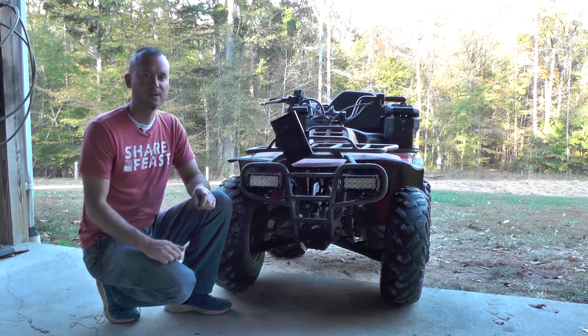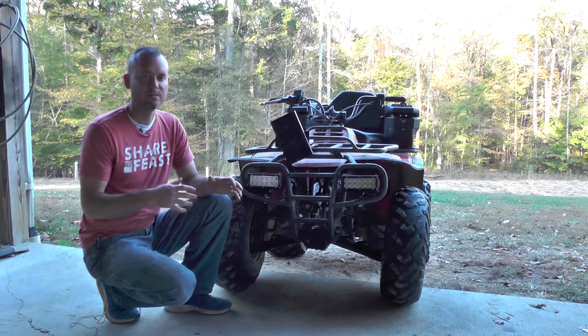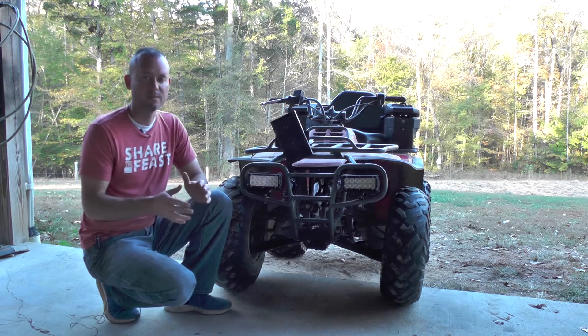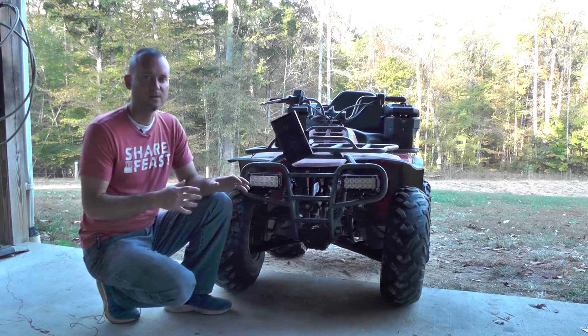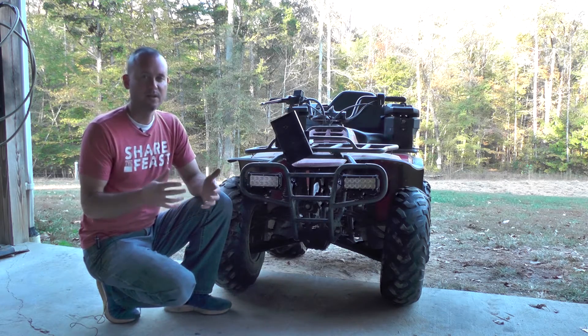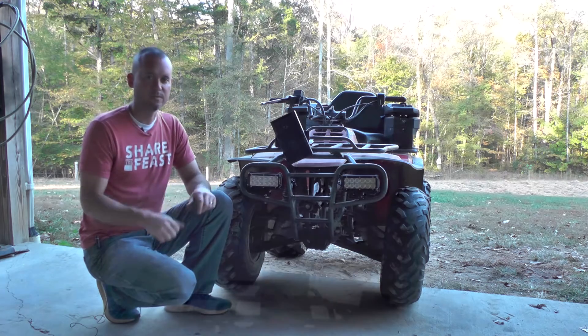A special thanks to John Smith — we've had some conversation back and forth on YouTube, and he was telling me how he had wired a lot of these lights in straight from the battery and put a toggle switch, a $2 toggle switch, in between, and that worked for him. This is a great wiring harness kit for the money, and the thing you've got to keep in mind is you're going to need direct power from the battery to these lights to make them work without pulsing.